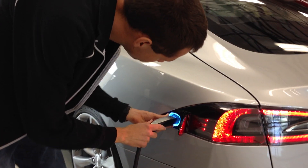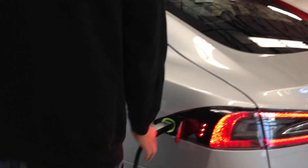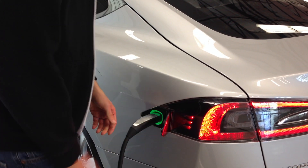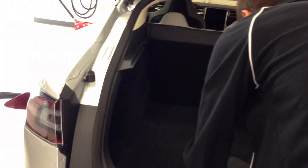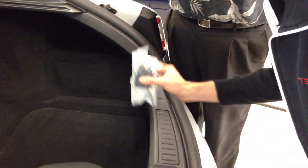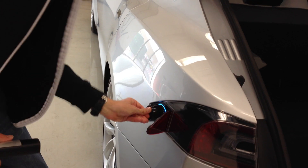One more thing: if you ever see the color yellow at the charge port, that indicates it's not in all the way — push it a little bit further and it goes to green. Now, I'll show you some of your adapters. Since you're going to be using a standard wall outlet at home, you'll put that adapter on the end of your connector. You also have the J1772 adapter, which is for public charging stations — you attach it to the end of the public charging station cord and then insert it into the charge port.